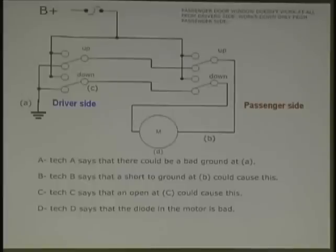What would happen if you put this switch right here, and you've tried the window up, you put it up? You pop the fuse. What would happen right to ground? You pop the fuse. That's right. You'd pop that fuse, right? Okay, so, it didn't tell you anything about popping fuses. All right, so, can't be that.